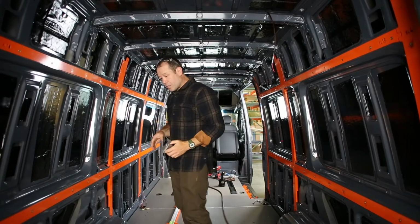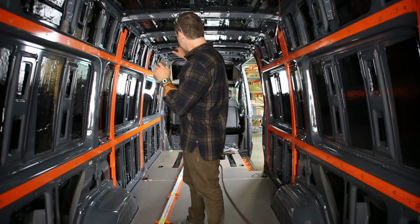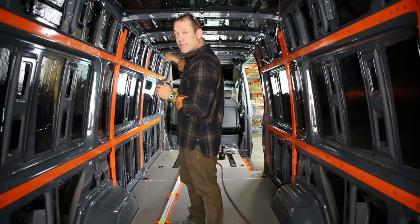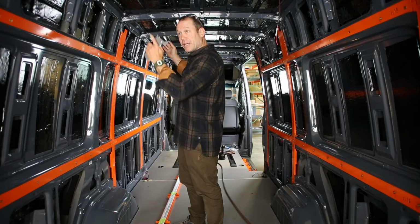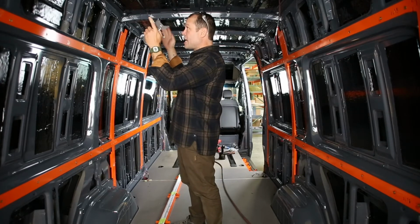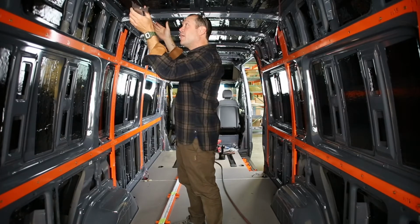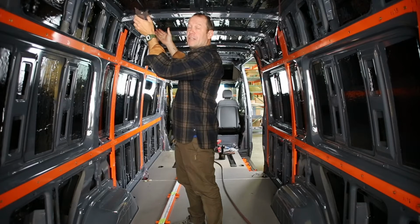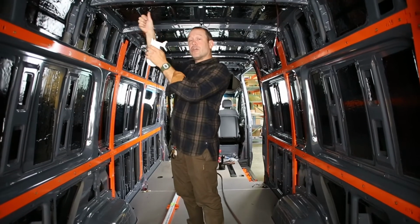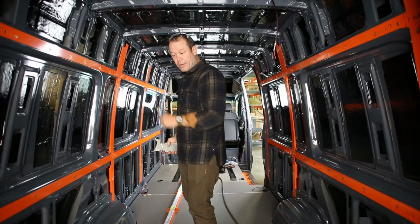It's important also that the front of this track is butted up flat against the front rib. Because it floats, you could potentially set all of this, tighten your side bolts, and have a gap up there. So when you put it up there, drive it forward so it's bumping into that front rib, then set your tools. All right? So with that, we're going to go ahead and put it up.